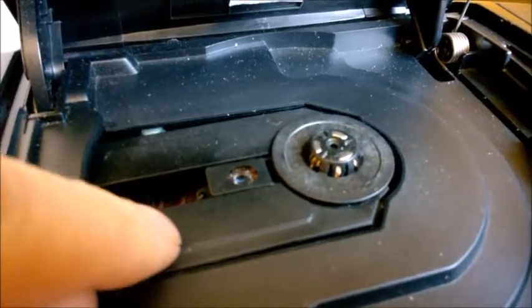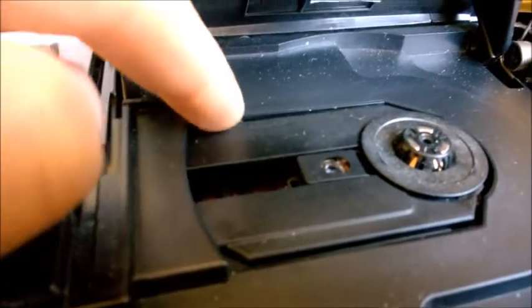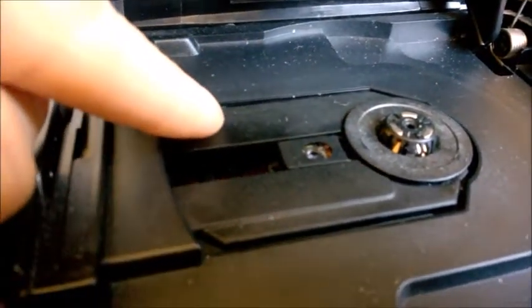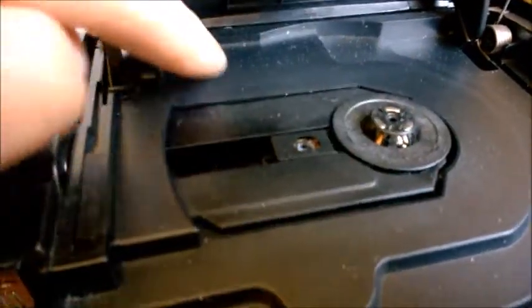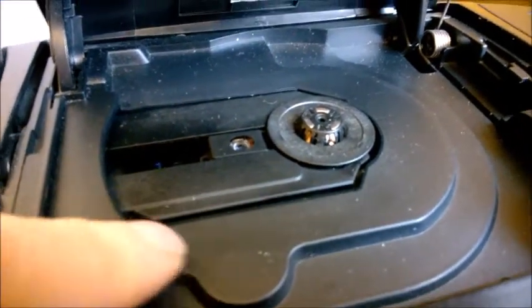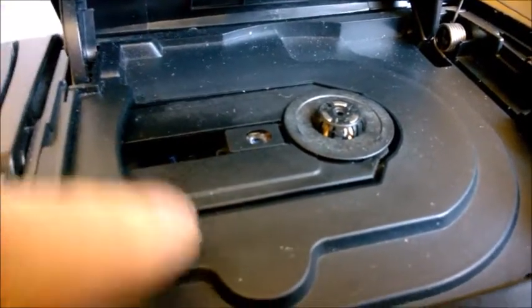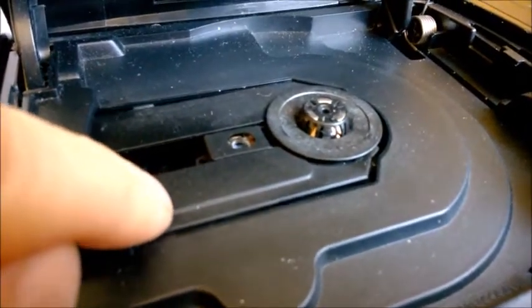The plate has damping on it, but because they start sagging with age, you can see this area is sitting lower than that corner. So it starts getting low, and at that moment when the CD is spinning, it's touching the solid surfaces — the surfaces that are not damped, not on the springs. The CD may just very slightly graze these areas while spinning.